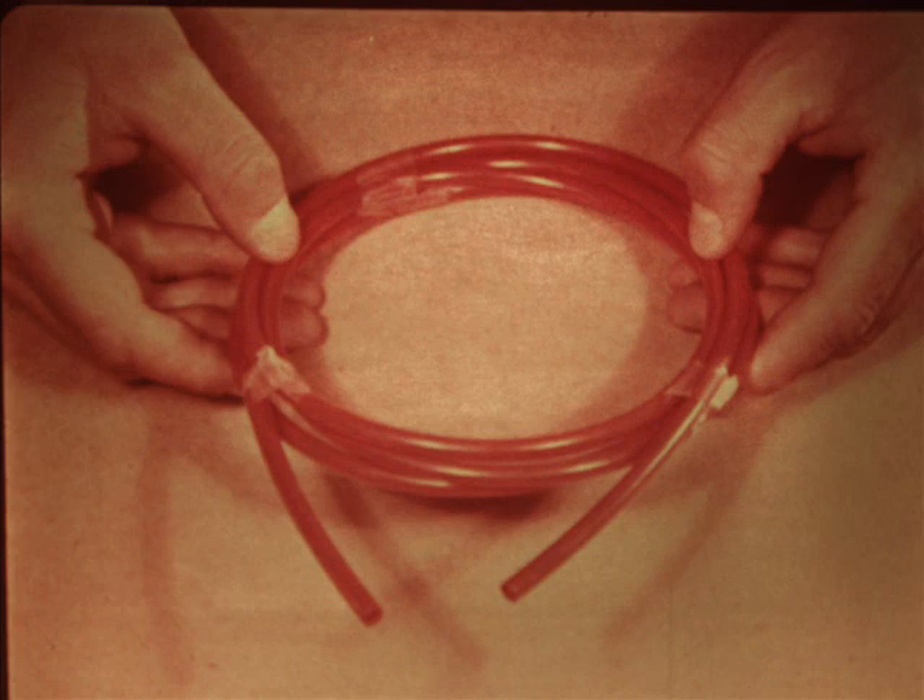The nylon tubing, besides being durable and weather resistant, is flexible, making it far easier to replace than a copper or steel tube. However, it is not resistant to high temperatures. Never route a nylon tube close to a manifold or exhaust pipe, and never weld close to it. Sparks can penetrate nylon, causing pinhole leaks that could be difficult to track down later on.